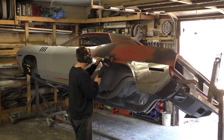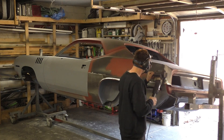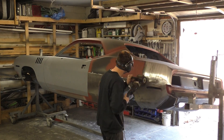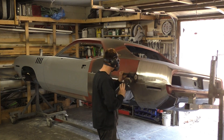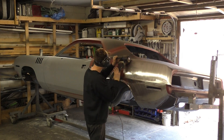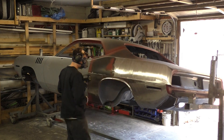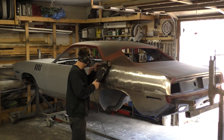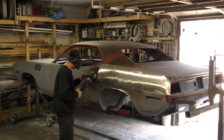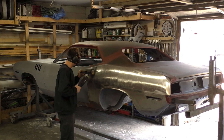It doesn't put a lot of heat on it and it just really does a nice job cleaning it right off. Personally there's no right or wrong way about stripping it. I do like to start in a certain direction and work my way over on the panel. I think the more even you can keep a panel as far as heat, pressure and everything, the better the body work's going to turn out. I am touching the quarter panel — yes it's bare metal. We're going to go over with wax and grease remover right after we're done and I'm just making sure the SCT isn't putting any heat on the panel or warping anything. I am running this at a high RPM — actually the highest it's going to go on speed — but I am putting very little pressure. That's what I found best for this e-coat.